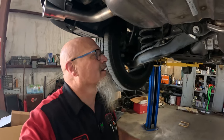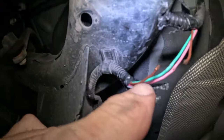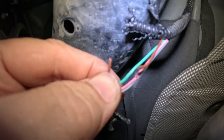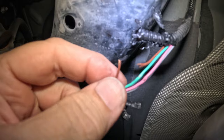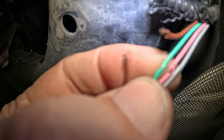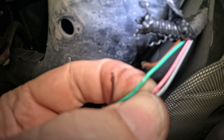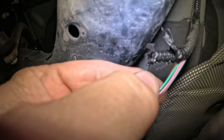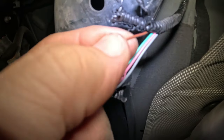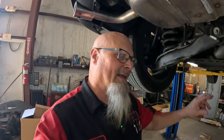I've got this thing cut open here so you can see that brown wire right there is completely open. Some of these other wires, the entire harness was hit, so these kind of need to be repaired too. But this brown wire — that's the open circuit that we're having, and that's causing the issue with the all-wheel drive system solenoid open circuit.